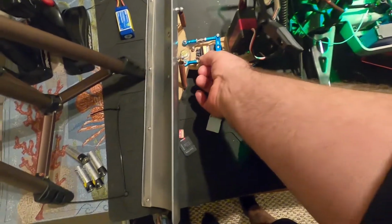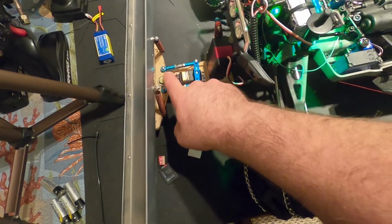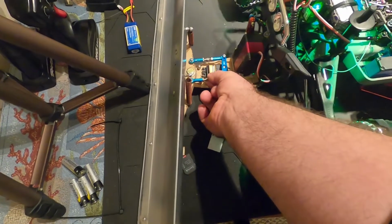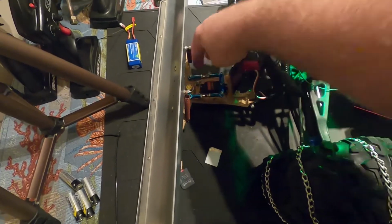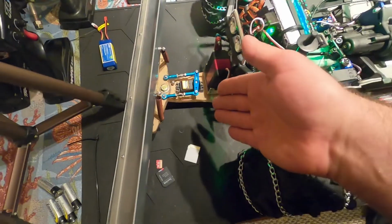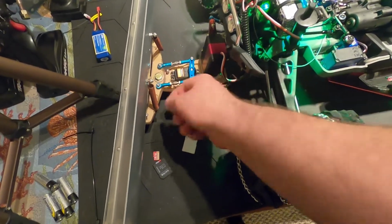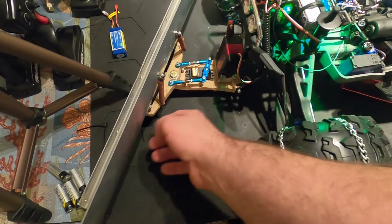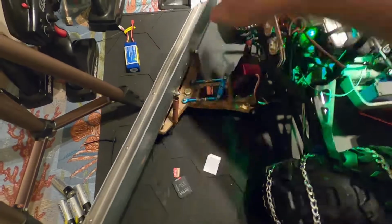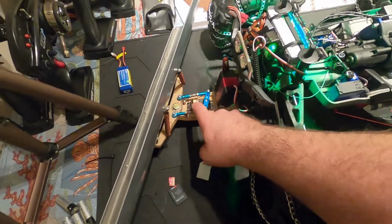Now guys, I have killed 1 servo on this already. I didn't quite have these adjusted properly, and when I went to lock, it was binding on them. I didn't have them set right, so when it twisted, one would move, one was crazy tight, and it wasn't quite sitting on my bump stop, and I ran into snow and stripped the gears in the servo. Put a new servo in, spent a lot of time setting the end points, so now when this hits lock, these are both loose, and it's on the bump stop, and it's perfectly set at its endpoint. So take your time there with that, guys.